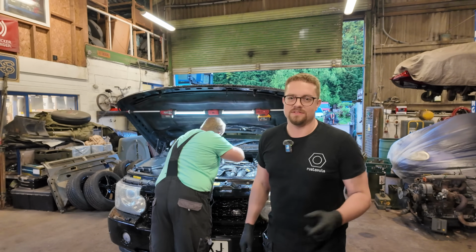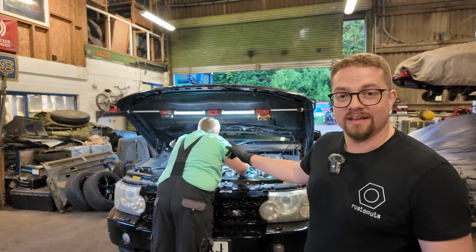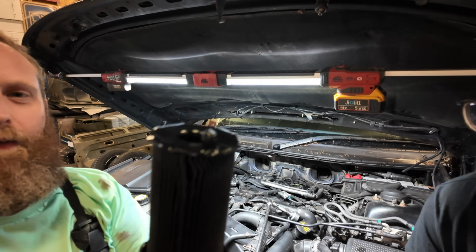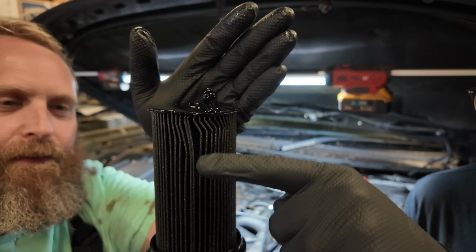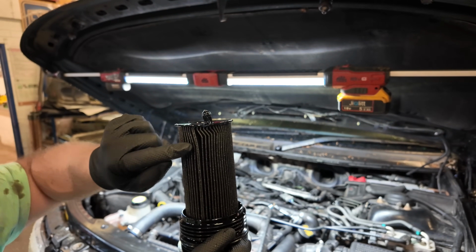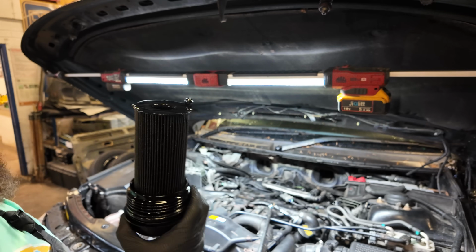Yeah, so we're going to take it off, see what the damage is to the oil filter. So just a word of warning, 35 Newton meters on the oil filter. If he says that, do it. Don't just ignore it. And you see how that is, whether it'll show on the camera, yeah, it's quite bent. There's a divot in here, and you can see where the filter's been damaged by these. You see the paper's off at an angle, so this has been folded over at some point.